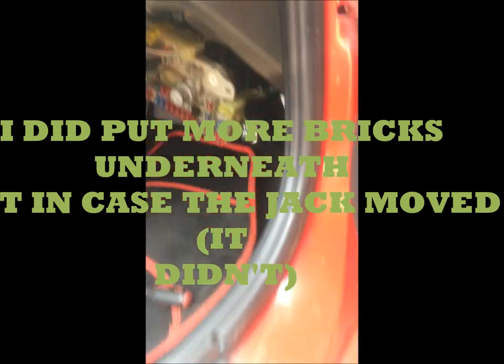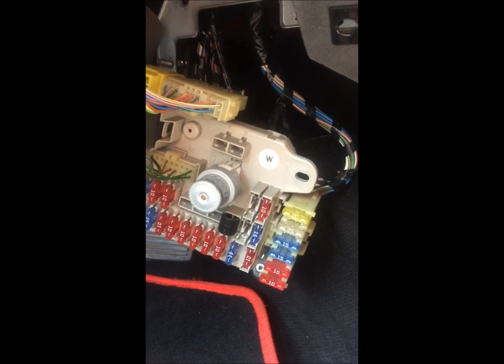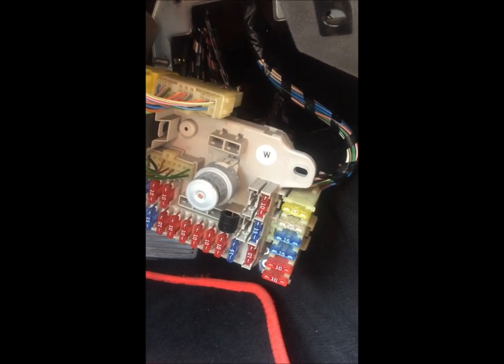So far I've removed the plastic cowling off the car. Here's the fuse board cover - it just sits up in here. All you've got to do is release one and then the other with a flathead screwdriver - it's a small half turn for each one - then it just releases and pulls away. Pop it out. As you can see I've had a bit of a stab at this one already.